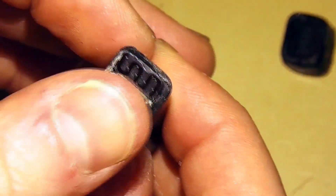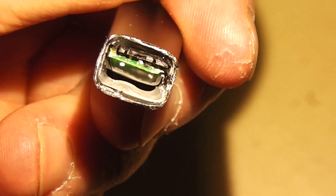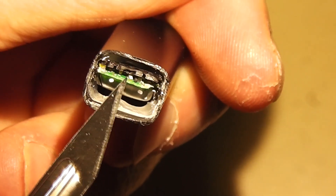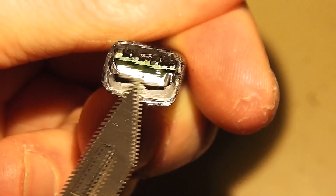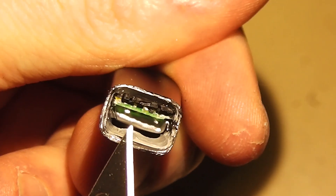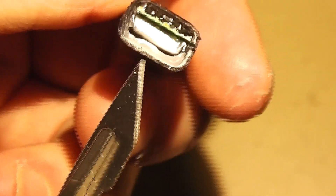I'm going to have a dig around and see if it's possible to remove any more without damaging the rest. Just remove the antenna — the antenna was held on with a single solder joint to the board around this point here; this was loose. I haven't had any problems with Bluetooth so I suspect it was damaged when I pulled this open. You can see the silver casing of the lithium battery pack on the back and a single PCB on the side here. There is some glue running around this edge — I'm going to see if I can remove that with a knife and hopefully slide this board out.